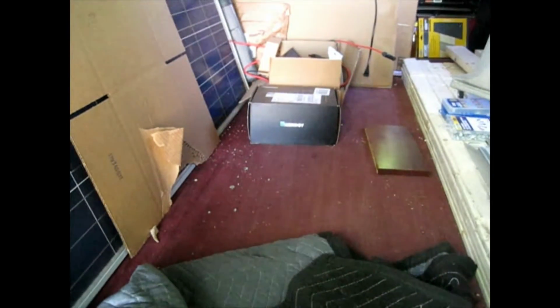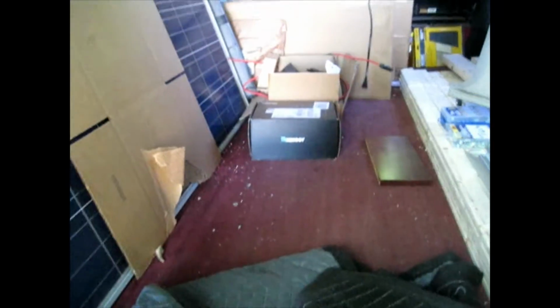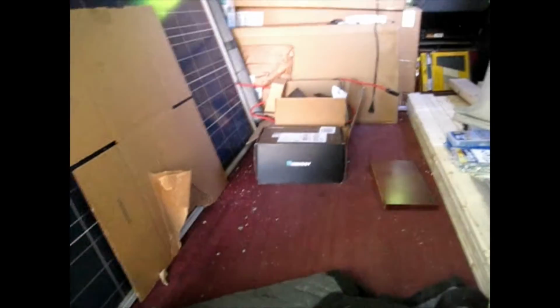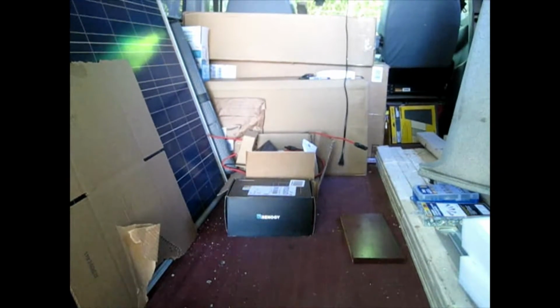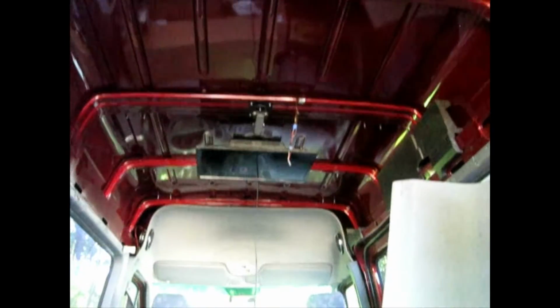I would have had this all probably hooked up yesterday, but I didn't want to move ahead myself. I'm going to take my time every day, a little bit here, a little bit there. But anyway, Renogy there. I got the bus bars, the red bus bar and black bus bar also over there, so I can put large loads wherever I need to be. I also ordered the fuse panel, which is a regular 12 volt fuse panel, because the only thing running on this here Juniper is going to be that television, I believe. That's the only power consumption I will be using.